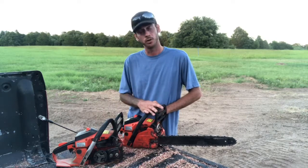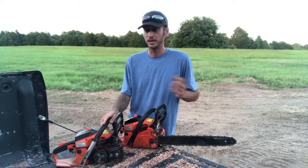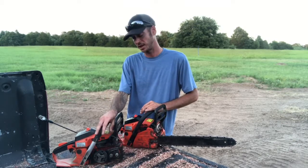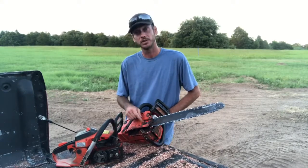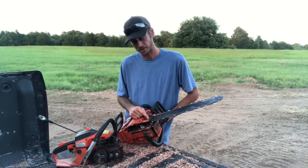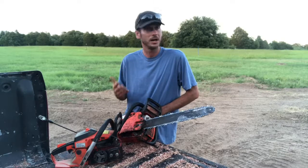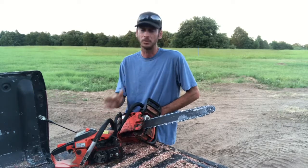This one has low compression but still runs with the idle turned up. I ended up having to steal some parts off this one to get the newer one running. Going back to the chain issue — you are not keeping the chain tight on this and I don't know why. I've changed the nuts trying to get better lock nuts on it. Both chainsaws have the same problem: the chain adjustment — where you stick a flathead screwdriver in — the housing it sits in is plastic. Had to replace both of those. They weren't expensive but weren't in stock. That's actually why I bought the second one.